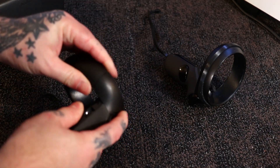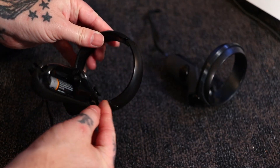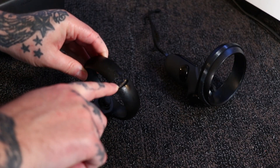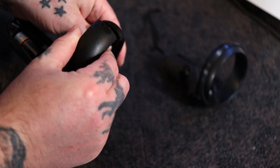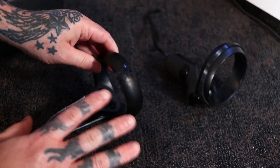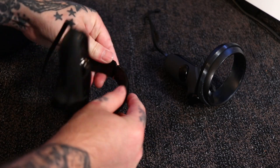A lot of people super glue it back together, but you can't - and as I've seen, you can't buy a replacement unless you buy a broken used controller, which is expensive, and then take it apart. Don't worry - this is actually your infrared sensor and it comes apart right here. This is not damaged or broken in any way, your controller is still fine. If you see a gap between them up towards the center seam, it's normal. That's how they come apart - not up here, this ring doesn't, but down here on the bottom.